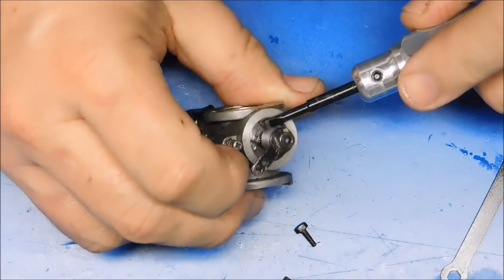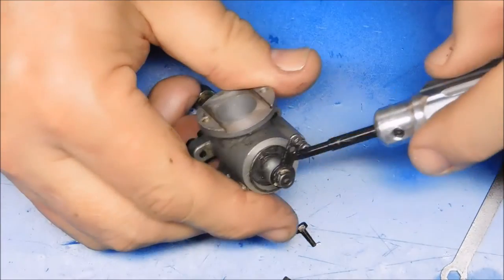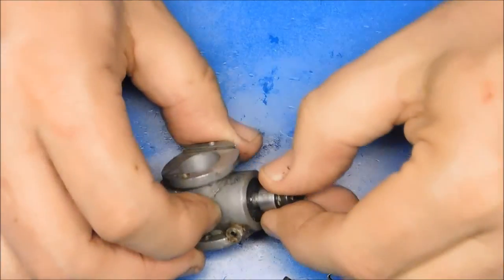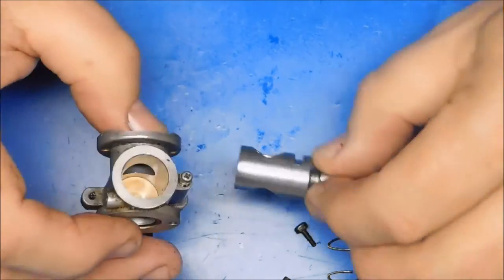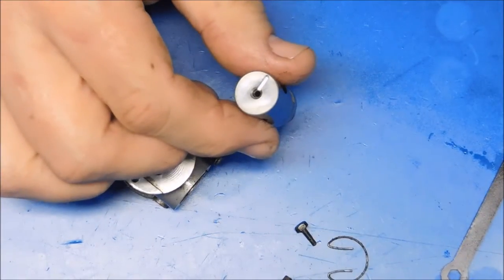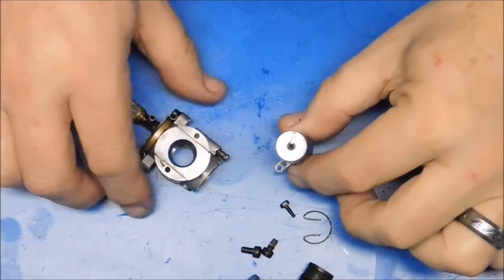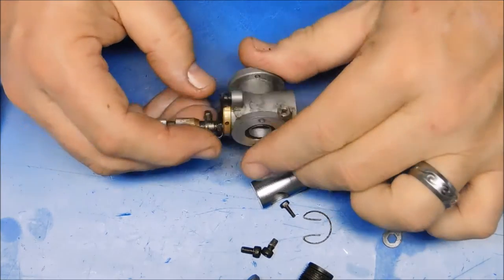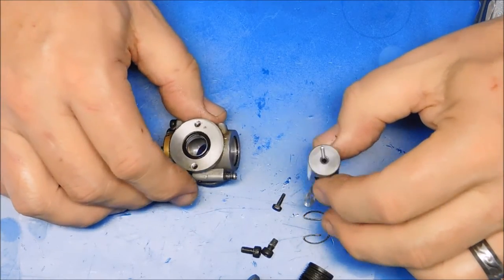Not really sure which way that clip needs to go to come out, but apparently this is how the clip needs to go to come out. So there's the groove — there's the metering groove that this rotating brass disc engages, or allows fuel to draw through.